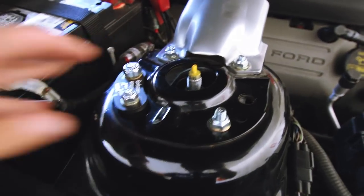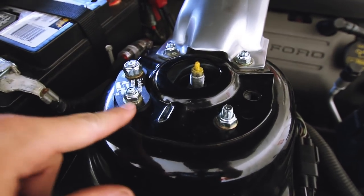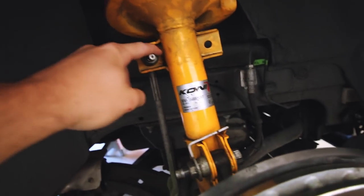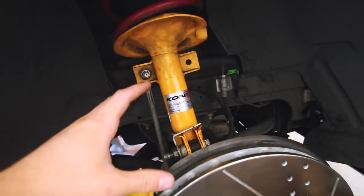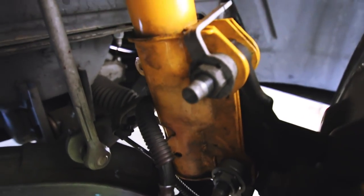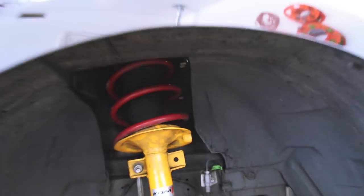Everything's pretty much done as far as the caster camber plates go. Here it is all installed — this is what it looks like from the top. As you can see, there's a little support right here, which is pretty cool. All the smaller bolts are torqued to 20 foot-pounds, and this bigger one for the caster is 26 foot-pounds. On the other side, we have everything torqued up. The instructions from Maximum Motorsports give you the torque specs, which is very helpful. We also have the new bolt down there, the bolt up top, and the caster camber plates installed. The alignment is going to be all over the place — you can't really see this mod on the car, but it's a must-have if you go lowered. Do not use those camber bolts — that's just a band-aid. I would highly recommend these; I'll have the link in the description below.